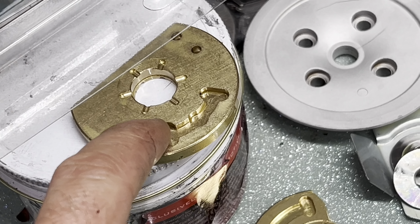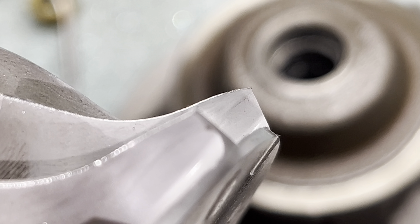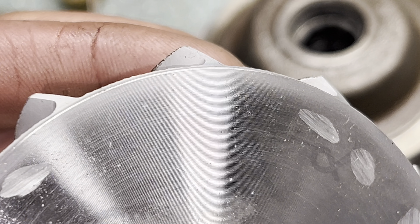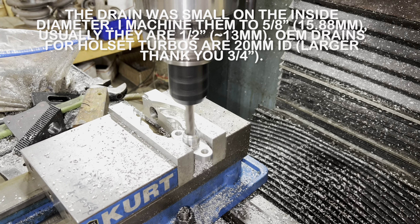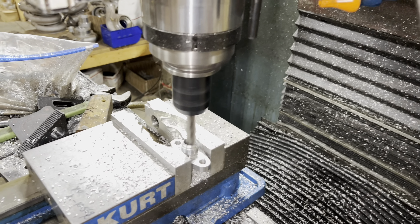That's why I brought it down here. The second issue is that the bearing housing is damaged right there, which is likely causing a problem with the seal going in. I'm going to have to take a file to that, same thing on the opposite side — file it down and see if we can get that seal to go back together. A couple things I want to pay attention to: this is the thrust bearing from his rebuild kit.